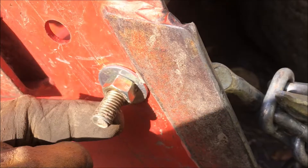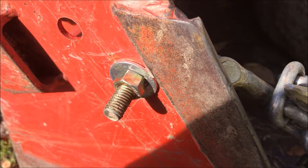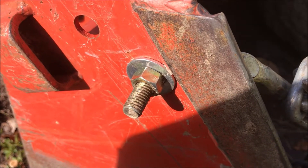The other thing I learned here: initially I did them with grade 2 bolts. The other day I had a grade 2 bolt snap, so I replaced it with grade 8. And I have yet to take the grinder and just cut the end off.